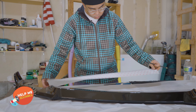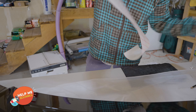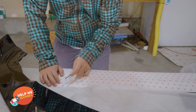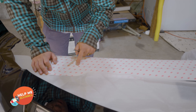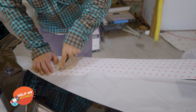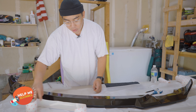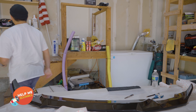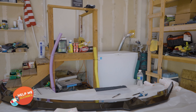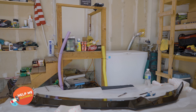Take it off and follow where that line goes — now you have it in a straight line. You're just going to want to trim in that general area to the shape of it. Again, this is just for preventative measures, so it doesn't have to be perfect and you can always trim it a little bit later. What I do here is use water — you can use soapy water. With water you get a little bit of a safety net when you're squeegeeing, and if you don't position it correctly you have a buffer, so that'll save you if you don't like the placement.